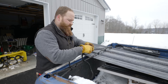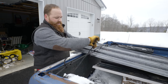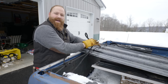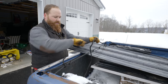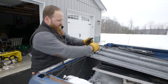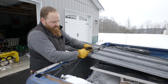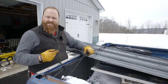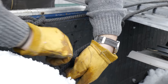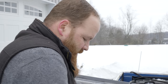If you guys are tying loads down in the back of the vehicle, there's a great way to make a knot that you can use to ratchet down. Now you can take this and tie a square knot and you'd have a loop, but the hard thing about that is that then your knot gets really tight. Let me show you the best knot after the bowline knot. You take your line, put a couple twists in it. Now this is the part of the line back where I'm pulling from. I have my loose end here. A couple twists, then you take your line and you put a loop through. From here you've created now a loop that you can lash to and ratchet from. And then when you're done, you just pull that out and it comes out really easily so you don't get that knot that's really tight. Just secure it with a little lock knot at the end and that's your trucker hitch.